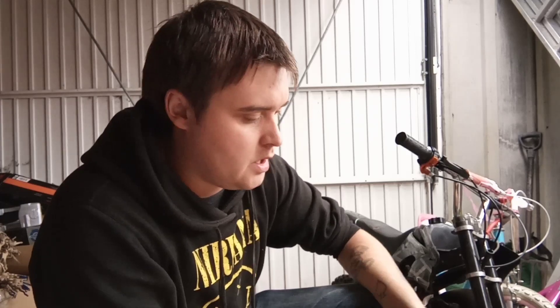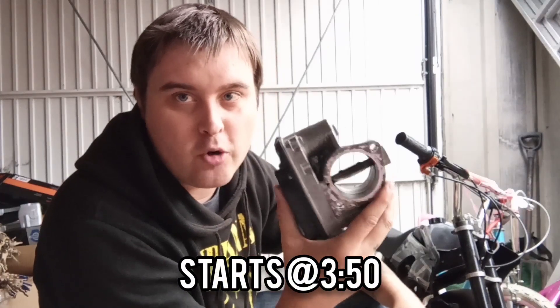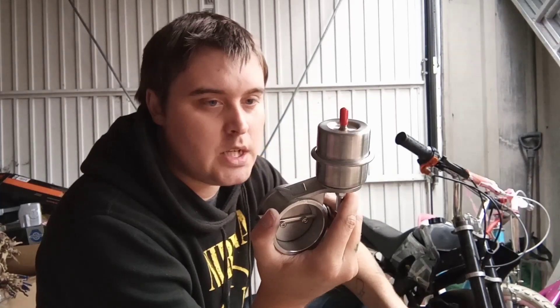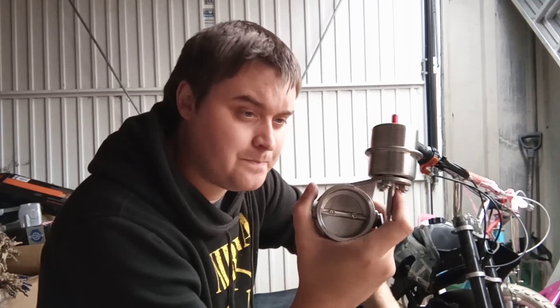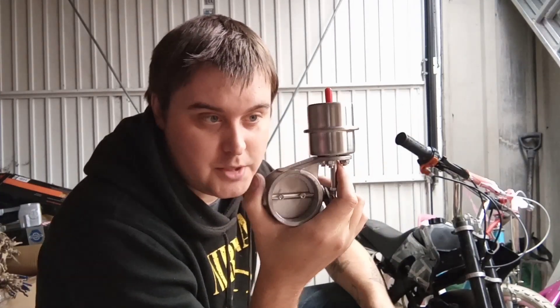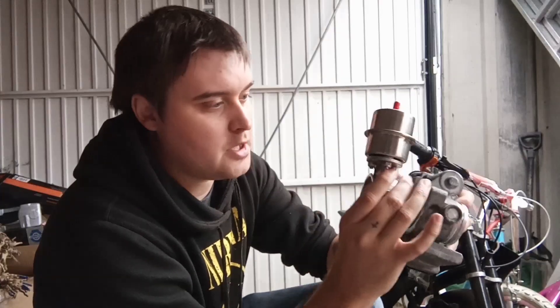Today's a simple one I've been wanting to do for a while - thanks to Casey it's now possible. This is the electronic bypass valve - we all know it, we all hate it. I want to try and replace it with one of these: a vacuum-actuated exhaust valve. It's cast stainless steel, which makes it ideal for my poor fabrication skills. It's normally closed, meaning when vacuum is applied it opens - just like the original would if vacuum operated. Both are 50mm, so in theory they should work the same.